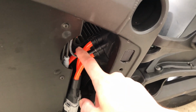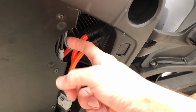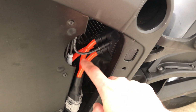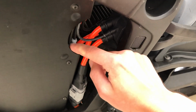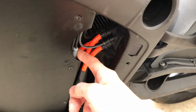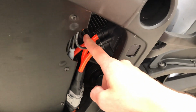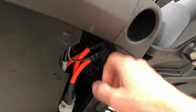We have the communication wire for the control pilot signal of the Type 2 communication. It is actually a loop between the CP contact and the earth contact. And we can see we have 3 orange cables. Well, this is my output to the chargers. We can see charger 1 and so on. Back here we can see the standard industrial connector. It's an M12 connector. This carries 12 volts from the chargers to our control box, and also the CAN bus communication. We also can see another cable here. This is a braided cable. This is our earth. So I take the earth and bring it to the frame of the motorcycle, like the standard charger.